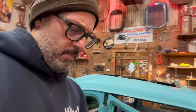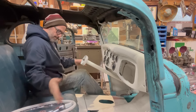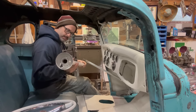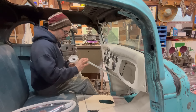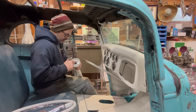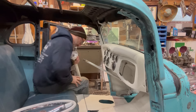I'm gonna grab that piece of stainless tubing and get to work on the steering column. I already pulled the steering wheel off. There's a little wedge piece that sits in the steering column that holds the steering shaft centered in the column. What I need to do is remove this bell and try to remove this piece of metal in here so that little wedge piece can fit back down inside the new steering column.